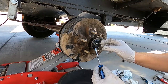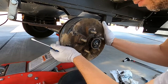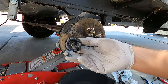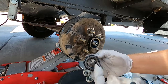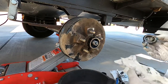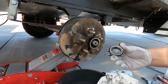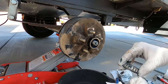Be careful with your axle bearings or wheel bearings — you don't want to damage those in any way. If they're scored or you see excessive heat marks, like a purplish color, you'll want to go ahead and replace them. But these looked really good, everything looked fine in there. I did spray them out with some brake clean. Then at the end it gets repacked, or you can repack it before you put it in — either way.